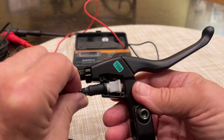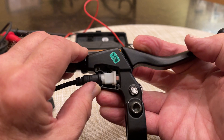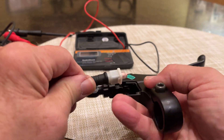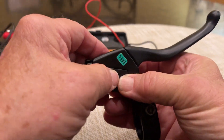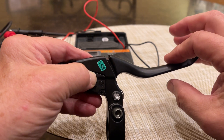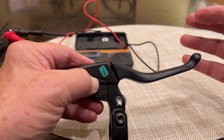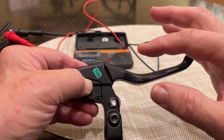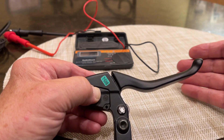Here's the actual inners inside, and you're going to hear in the background a little beep — that is my continuity tester, a volt-ohmmeter back behind me. So when the brake goes on, you can hear it beeping back there. This little switch is what does all that; it's underneath that cover in there. You stick that in there, cover goes over the top, there are some screws that hold it in place. What I've duplicated happening here is if the brake handle doesn't fully come back — it's almost back — and if I let go of it, it's still on for a second. During that delay, you take your hand off the handle and you're dead in the water. You've got no motor power from throttle, and you've got no motor power from pedal assist. That could be a possible explanation for these intermittent brake problems.